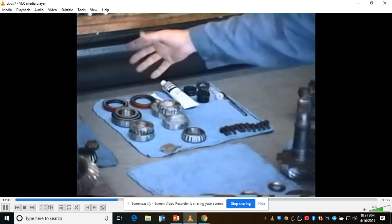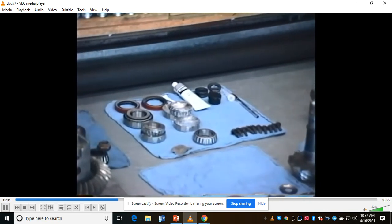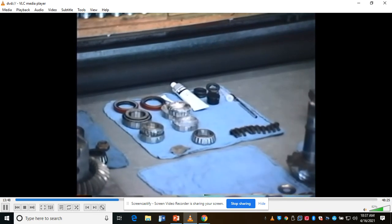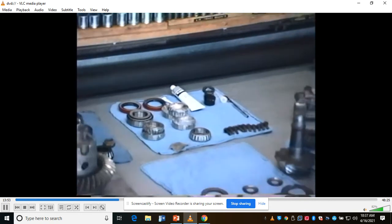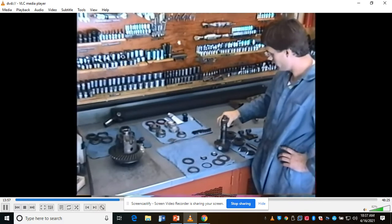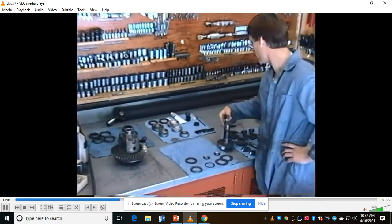They gave me two seals. The coverage is for multiple cars, and so one of those will work for the front of the housing to seal the pinion gear holes and stop spill out the front. They give you a new crush sleeve, okay, that sets the bearing preload. That's what sets the preload on these two tapered roller pinion bearings that fit on the shaft.